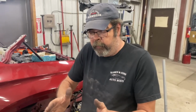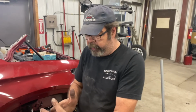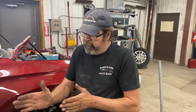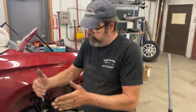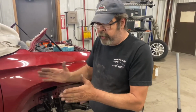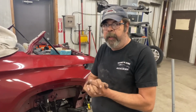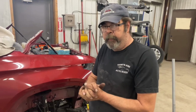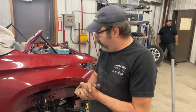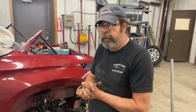Sway is when the front end is one way or the other. Mash is if it's crushed. Diamond is if the frame does this, which a unibody cannot do. It crumples in different zones. The structure itself will stay the same. So in the next video, you'll see me pulling the rail out, drilling the rail, and putting the new one in place, getting it welded up, measured, make sure it's correct, and then we'll get it painted and get the drivetrain back on.